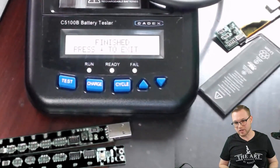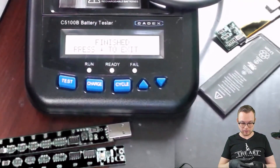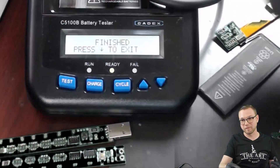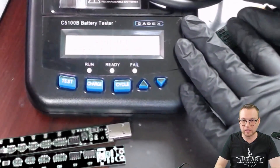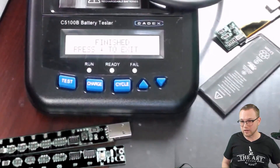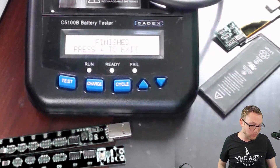Now that the test is over, normally what you're going to see is an answer on the screen — it'll say the battery is good, intermediate, or bad. But if you purchased the printer unit and set it up that way, it will print out a little slip you can give your customer. The test was the QuickSort 4 test, the result is a good battery, it gives you the testing date and all kinds of information. This is a great addition to pretty much any store — it takes a lot of the guesswork out of battery testing. I do like that it checks the electrochemical dynamic response of the battery itself. I do believe that to get a truly accurate statement on a battery you need a full discharge-recharge analysis, but outside of that it's a really nice test — it gives you a really quick answer and you could save a lot of money with it.